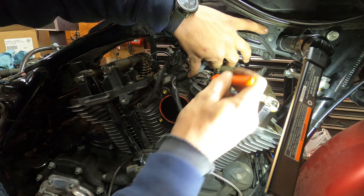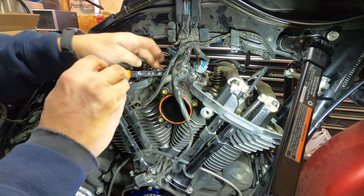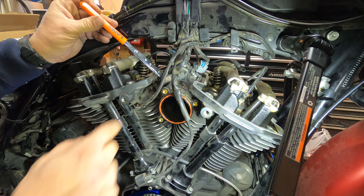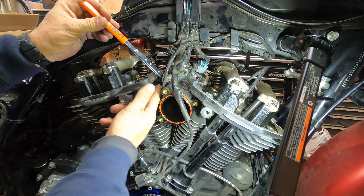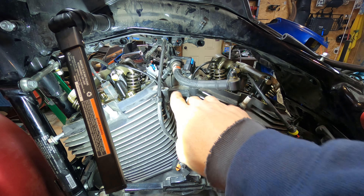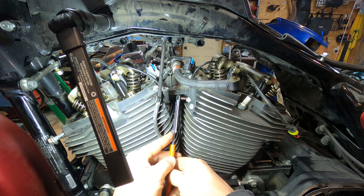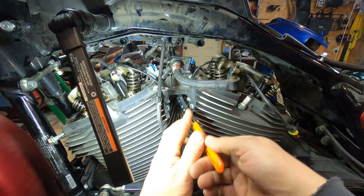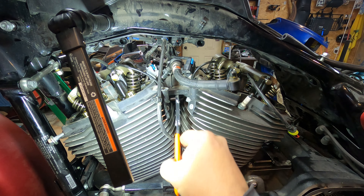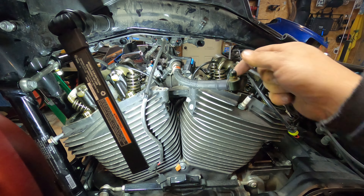To get the old intake out you're going to have to be at a severe angle — that's the purpose for the ball-head bit. The rear cylinder bolt is a little bit easier to get to; the angle is about like that to get that bolt out. Now the right-side ones are loose. These are quite a bit more accessible, a little bit easier to get to.